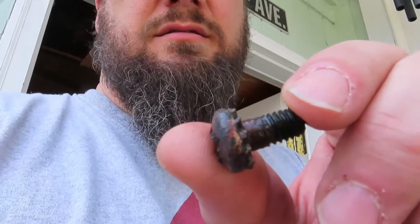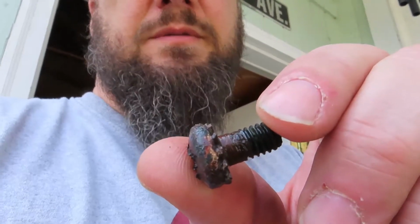They're not very long bolts. That's cool. So, I mean, they're only that long. So, I'm only going to be drilling in, what, not even half an inch. So, we'll step it up, and then worst case scenario, I've got a tap and die set. I'll just find that thread pitch, and we'll just cut the old screw all the way out once we get close. So, I've done it many times in the past. It seems to work. Should work this time. I don't see why not.